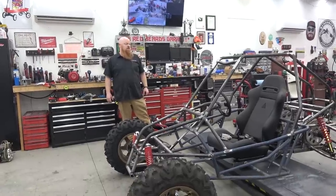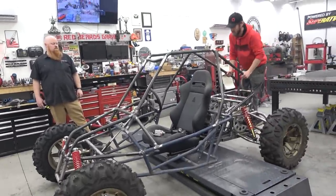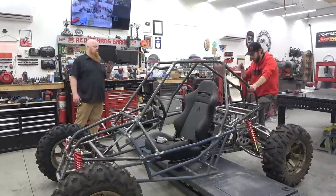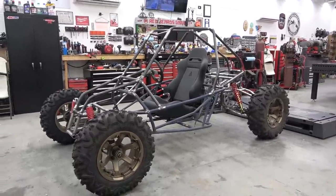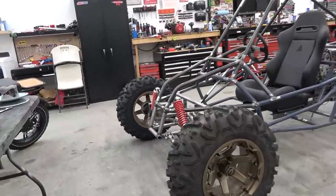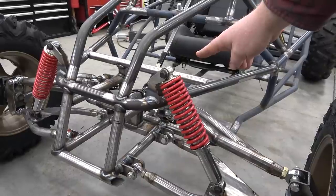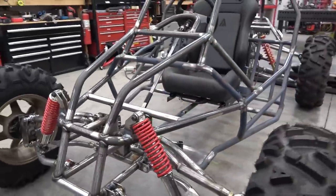The back actually feels good if it was just taller. It looks sturdy. If we make the bottom go in it'll make it softer, but we've got to clearance it. The buggy's on the ground and it's looking freaking sweet. I think these wheels really look good on it — everything turned out awesome. I'm going to remake some new front shock mounts and get the matching shock for the opposite side. All I'm going to do is stand the shock further up — probably go about out here, tack something in, test it, and if it needs to go further, probably like three inches out. I think that'll fix our problem.